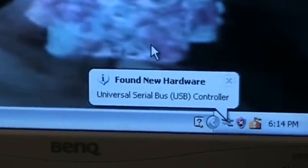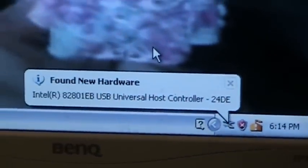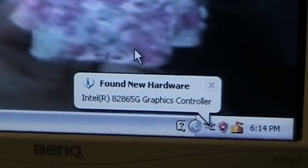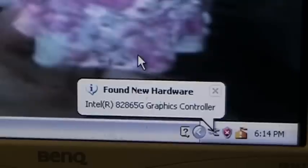And when I chose the disable automatic restart on system failure option, it actually came up and booted, and now it's finding all the hardware that's part of this system. I would think that the two have the same chipset. They're probably both 865 or 875 series systems. This is an 865, okay. So there probably is a little bit of difference. The other Optiplex probably had an 875 series chipset. And okay, it didn't crash.